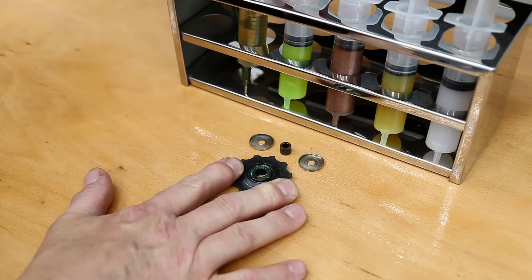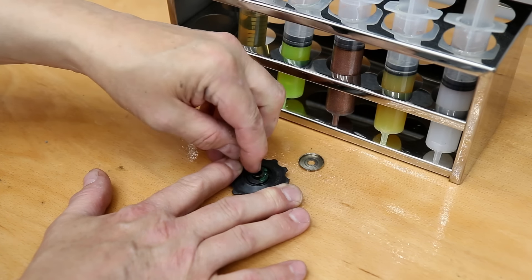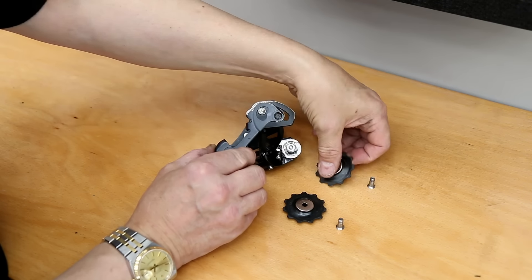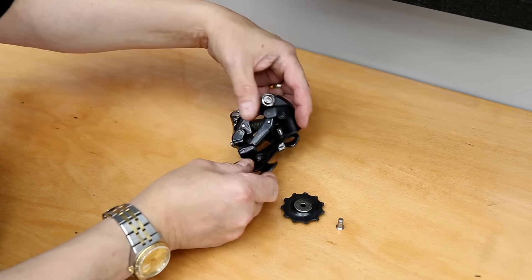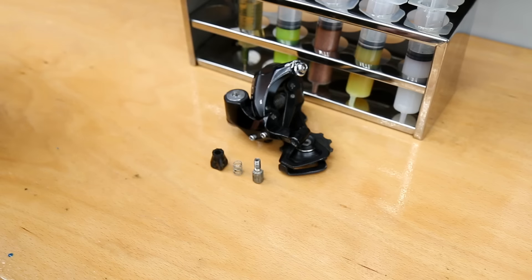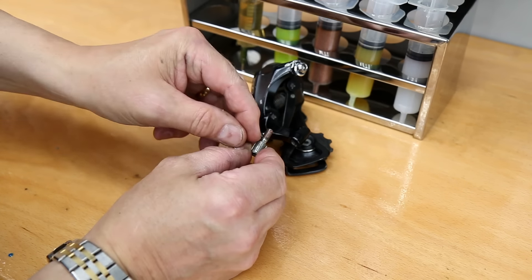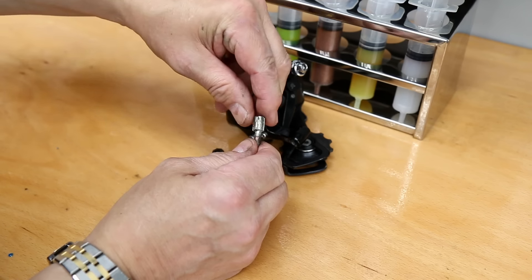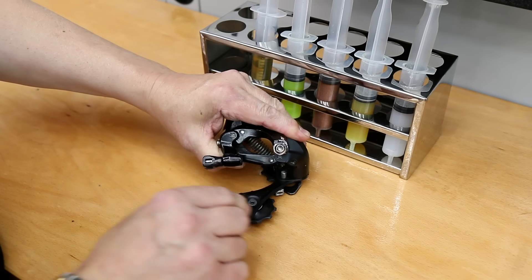Jockey wheels being greased now — premium grease on the pivots in the center. I'm using a Park Tool thread locker to hold the pivots of the derailleur jockey wheels in place in the cage so they won't come loose on a ride. I also lubricate the thumb adjusters using a little bit of copper grease on the thread and general purpose grease on the adjuster itself — these will often seize, so I make sure all thumb adjusters on the bike are lubricated.